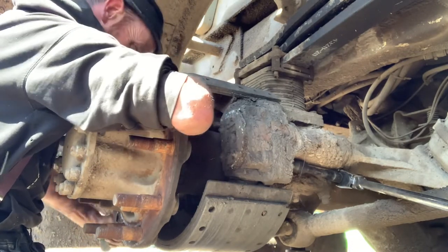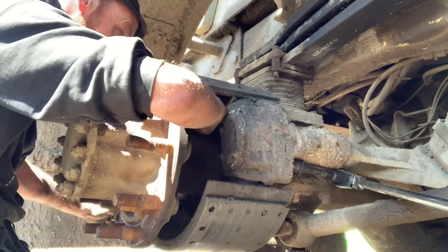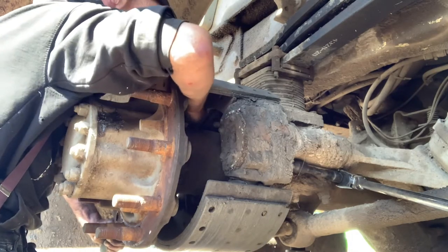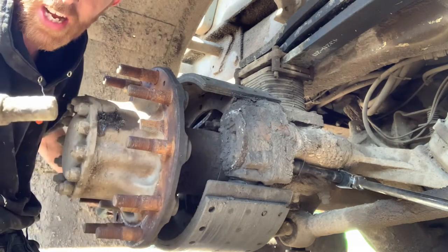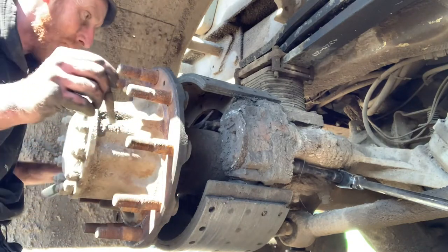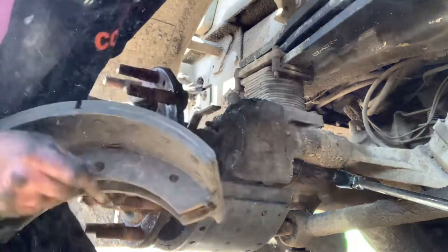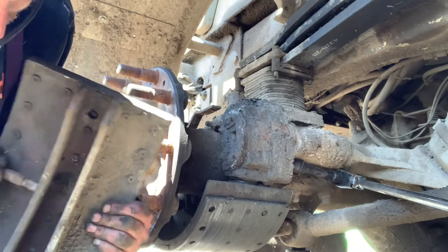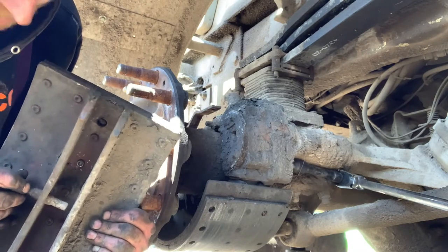This is going to be seized, isn't it? The trouble is when they get corrosion on the pin, you don't want it coming through the hole in the brake shoe, and that's what's happened here. Because them pins are rusty it makes them a bit chunkier and it's harder to get out of the brake shoes. There, look - there's slots in the brake shoe like that. It's tight, look. I've just got to clean the holes up and I've got to clean the pin up before I put the new shoes on.